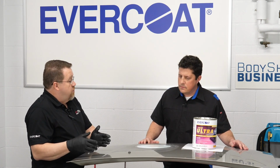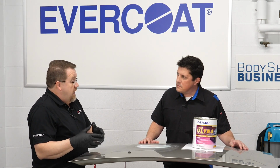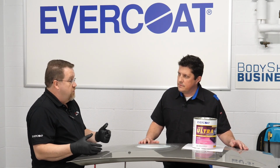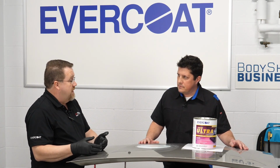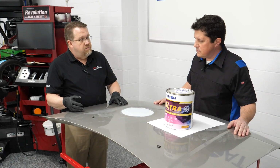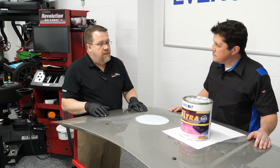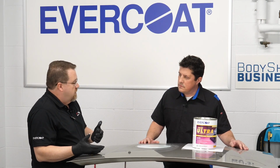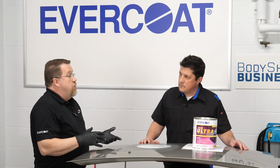And likewise, if it were going to be used in the summertime and it's got a higher ambient temperature, it doesn't take quite as long for it to kick off, so it's going to be a shorter working time and a shorter sand time. We still want to stay pretty true to the catalyst rate at 2% and using the information on top of the can. Because if we go radically low, well, then we're under catalyzing, possibly. And if we go much higher, then we're over catalyzing.